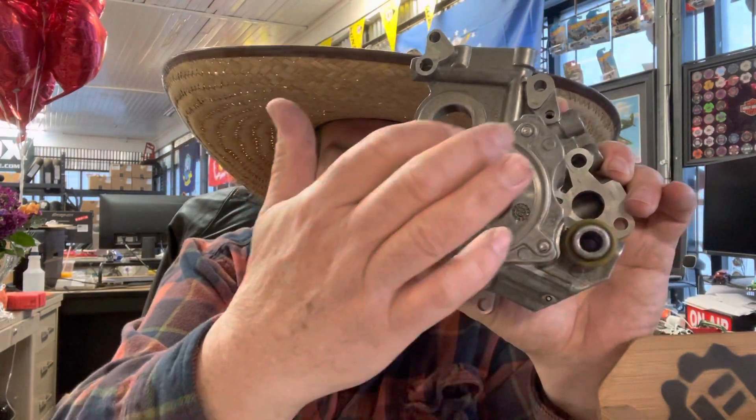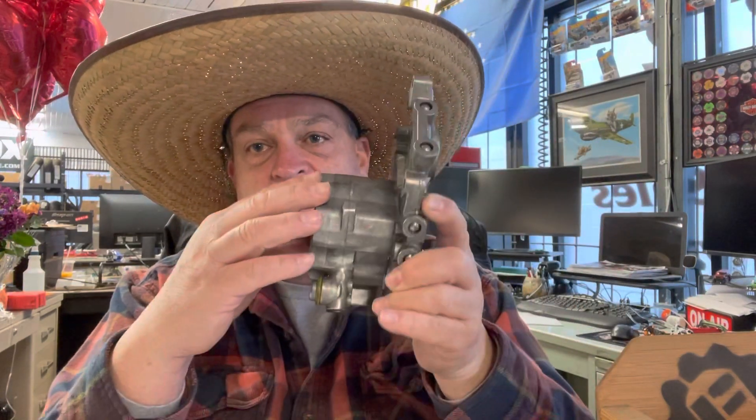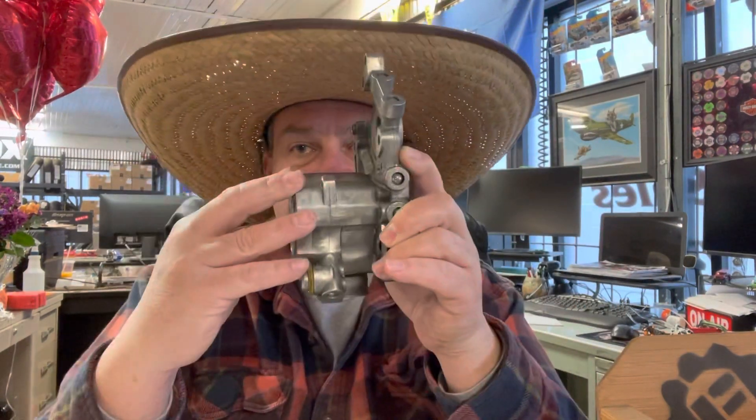What they did: if you look in the back of this pump right here, they machined a little groove and they added an O-ring — essentially a fat O-ring that goes inside there, goes up against the engine case — to help with the scavenging. The run-out on the flywheel on the pinion side preferably needs to be under three thousandths. Most of the time with Harley cranks, they are under three thousandths, which is pretty good.